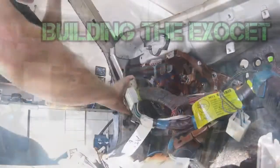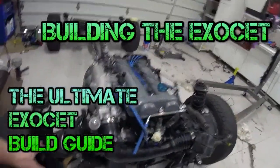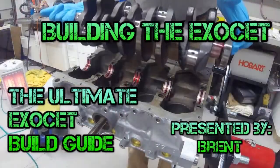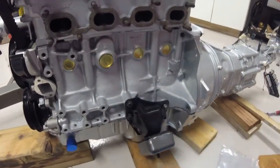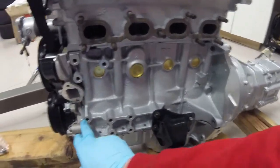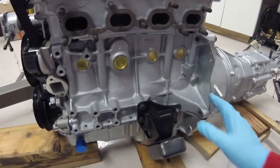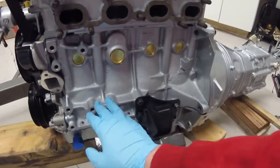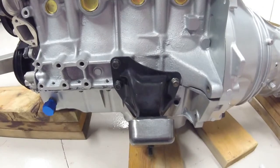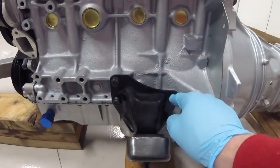Before inserting the motor, I'm going to be installing the motor mounts onto the engine block. I was a little confused with all these different holes on where the proper location to bolt the motor mounts was, but talking to a couple of people, I found out that there's only one direction the motor mounts can be installed. The rest of the holes are for front-wheel drive cars, for mounts and so forth. This is the driver's side mount — just to give you a good visual on the shape and area that it sits in. This side takes three of the four shorter bolts.